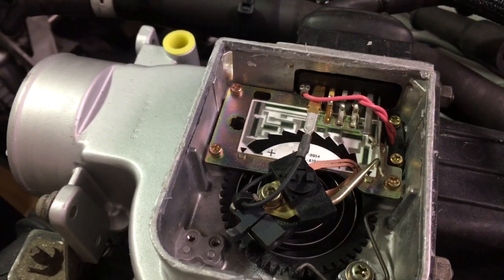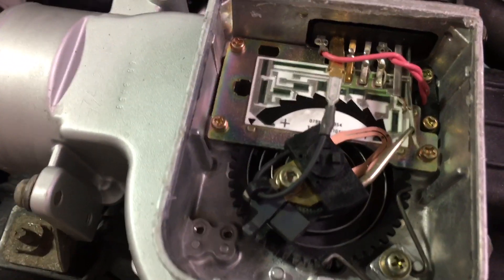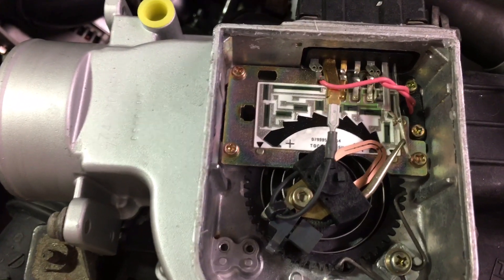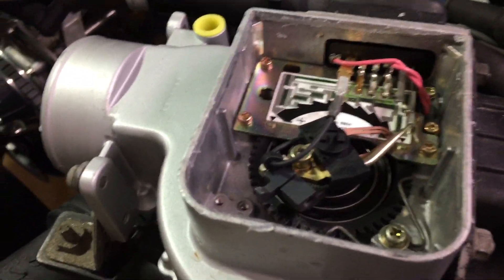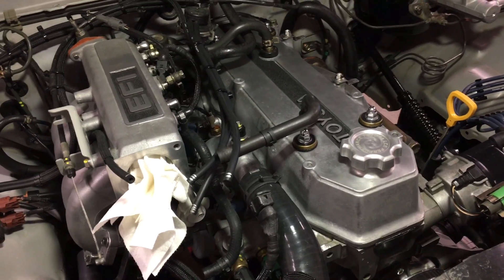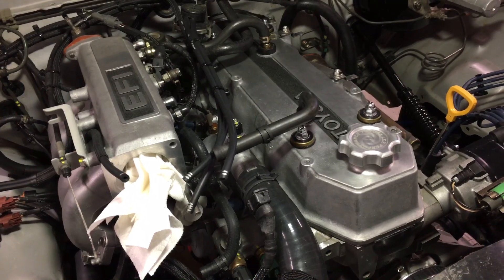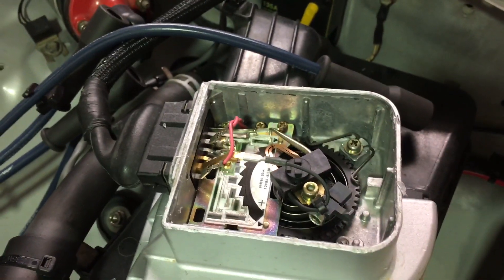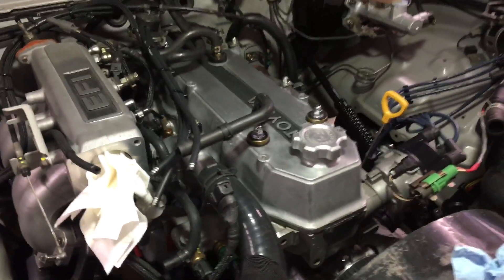You can also see something interesting — I'm opening this up and working on the little arm for the airflow meter, and I'm going to do some fine-tuning adjustments. The reason is that when you make modifications to the motor — I'm going to be putting in a new cylinder head and cam — you can throw off the airflow characteristics that the ECU is expecting. So you open this up and compensate with that little wheel in there to kind of trick the computer.